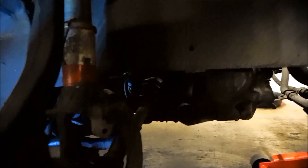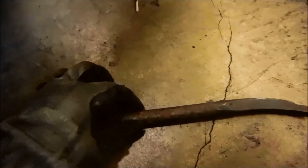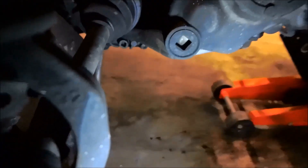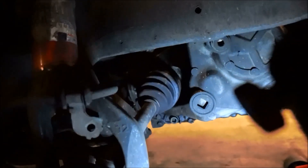I usually have a lot of bad luck taking the axle out of the transmission. Usually people just keep prying and prying at it, but I've actually had very bad luck doing that. What you need is a thick bar — at least probably an inch thick, maybe three-quarter inch — feels nice and tempered. Put it in between the axle, get some light, and you kick the living hell out of it. Just bust it loose. Don't treat it with respect — just karate kick it and it'll come right out.